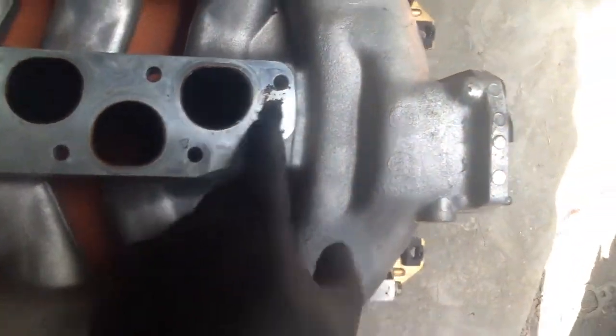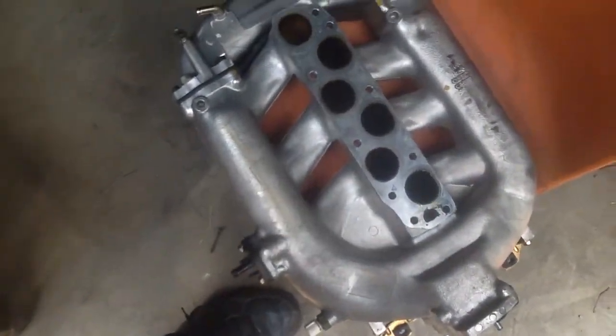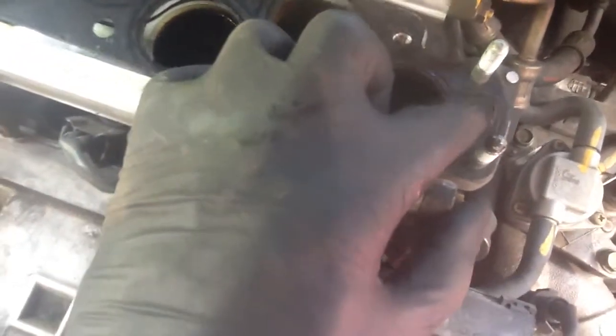So what you want to do is clean that port out and blow it all out. I have a couple of tubes out here, pipe cleaners, and some spray to clean that port out. Then over here on the engine, this is where the intake will sit — that's the gasket, that port is here, it's another area where it flows, so we'll clean that out too.